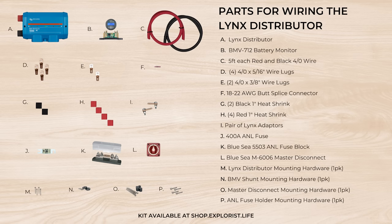With the new battery wired to the pre-existing circuits, the camper is now operating with much more power. If that's all you were interested in, you could actually stop here if you had a lithium-compatible converter. But we want to be able to power our 120-volt outlets from our new battery without having to plug into shore power — and that's coming up next. Wiring the Victron MultiPlus inverter charger so that we can power our 120-volt outlets from the new battery and recharge the battery from shore power is up next. First, we need to splice into the OEM shore power inlet and breaker box, which can be intimidating, but we're going to show you how to make it easy.